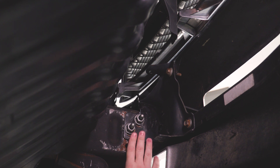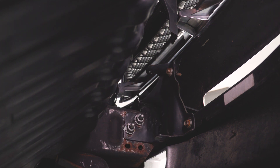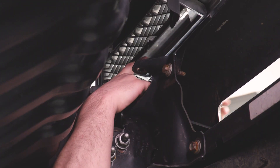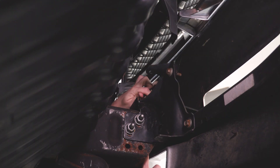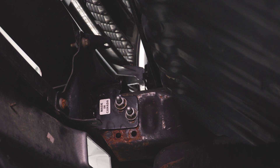Underneath the truck, what you're looking at right here is the driver side frame rail. On top of that, you'll find one 21-millimeter bolt head. If you have the tools to get to that, it'll save you a lot of time. However, if not, you can remove the grille and that will give you a bunch of access to this. This is the fastest way — this is the way I like to do it. And when we install our new bumper, this isn't gonna be reinstalled. Now we're gonna do the same thing for the other side.